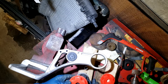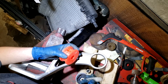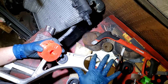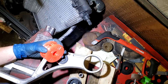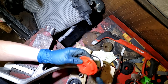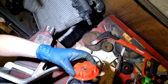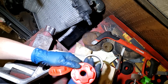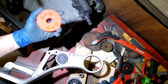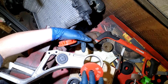Installing the new bushing is the easy part. For this mount you'll get two rubber bushing halves and one steel sleeve, and you should get grease with the order as well. The grease you want to put inside the bore of the mount, on this edge, and the same on the other side. Then grease all the outer edges of the bushing where it will slide in, and the face where the bushings will touch each other inside. Make sure you get some in the inner bore where the steel sleeve goes through - same for both halves.